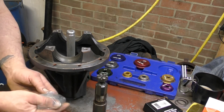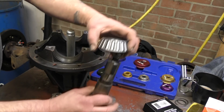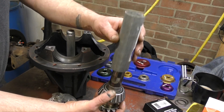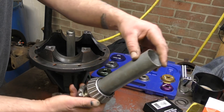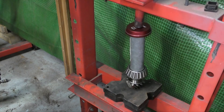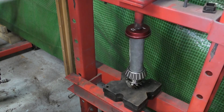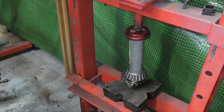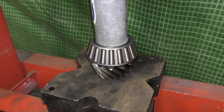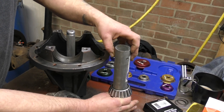Like I said, you don't use the handle on this. The main pinion bearing fits on the pinion like so. As you can see, you have a problem unless you have a tube — the idea is to push on the bearing race and do not push the cage, because a damaged cage can cause all sorts of problems. I'm using — it's not a scaffold bar, it happened to be a galvanized washing line tube. It's not very thick but it's strong enough to push the bearing into place. That's how it's done.